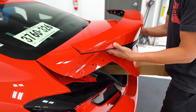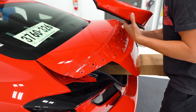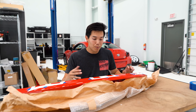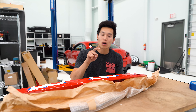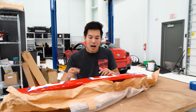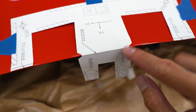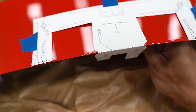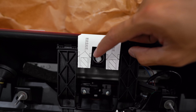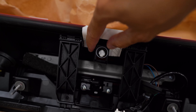We'll need to fish those harnesses out. With the trunk lip off the car, I've got the three templates included with the duckbill installed on the lip — they're clearly marked center, left, and right, so you can't put them in the wrong positions because they just wouldn't fit anyway. Each template has a dotted line you need to fold over, and if you flip the lip over you'll see it fits perfectly into the gap on the outside of the retaining clips and into these slots. This needs to fit perfectly into those slots and the dotted line needs to be right on the edge — that's how you align the center one.